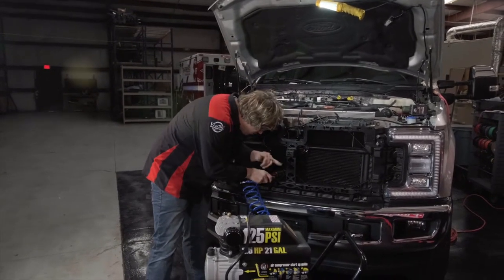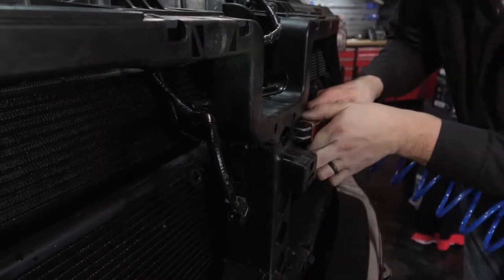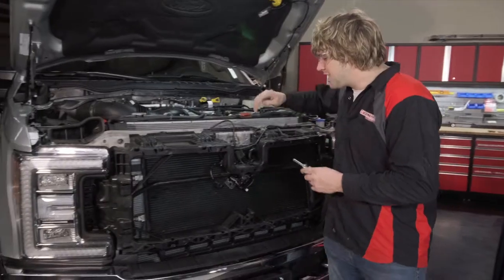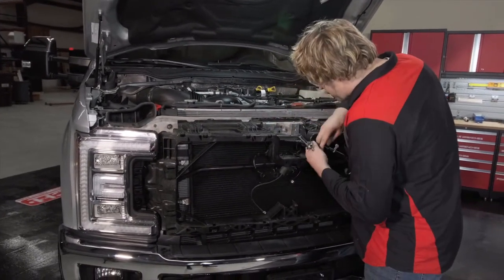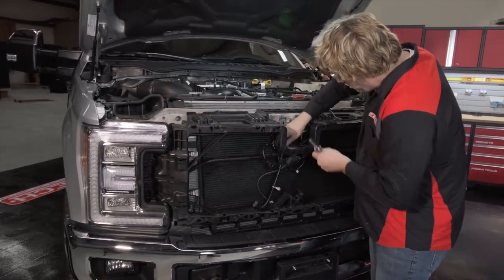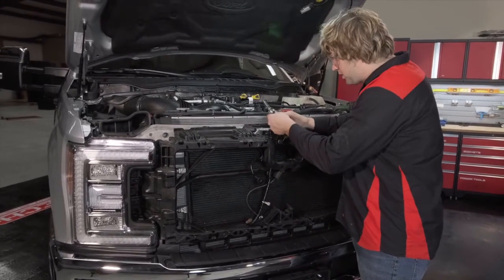Line it up and run it right through the front — it's clear. Next, put the hood latch assembly back up and pull the rest of the hoses and cables back down so they're where they belong. There's your washer harness and your video camera feed harness. Once those are out of the way, pull the latch assembly back up into place since we're no longer working in this area.